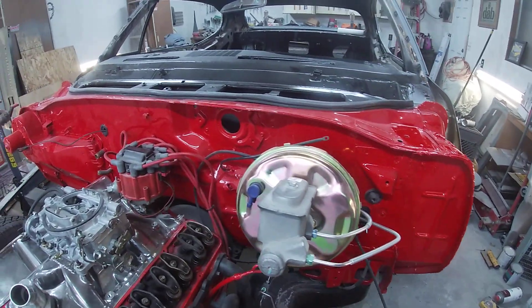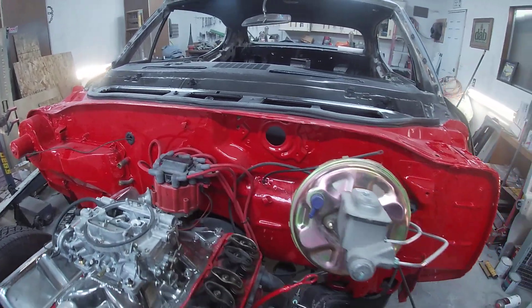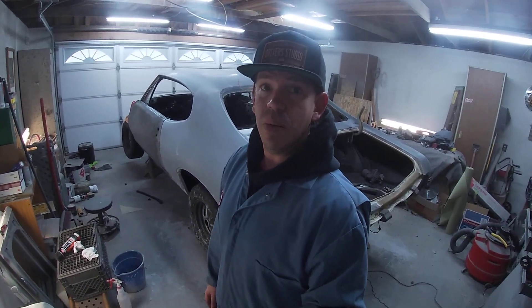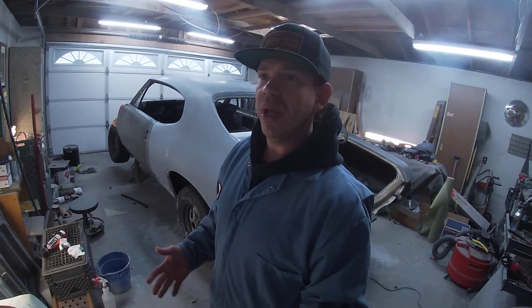It's a bit dusty from working in here, but it's a beautiful rich red. Didn't do much crazy stuff for the firewall — tried to prep it as best I could, shaved a couple little things, but it's pretty much a stock firewall. The engine bay side of the inner wheel wells will be done base coat clear coat red as well. Then the tire side of the wheel wells will be done in black bed liner — I find bed liner repels dirt, mud, and water better and is easier to clean than undercoating.